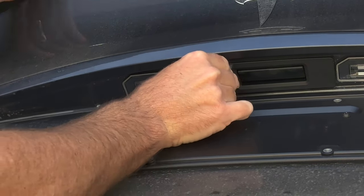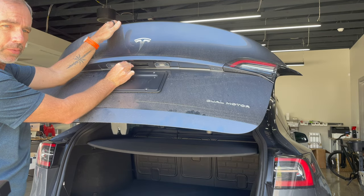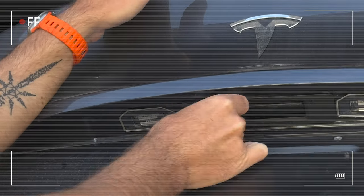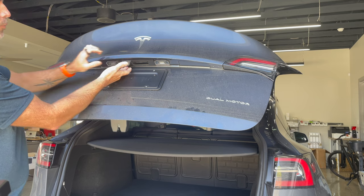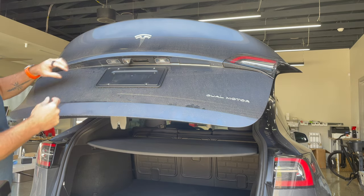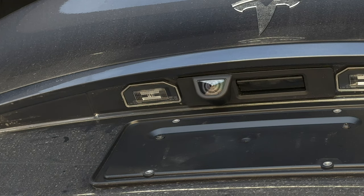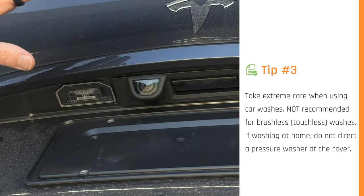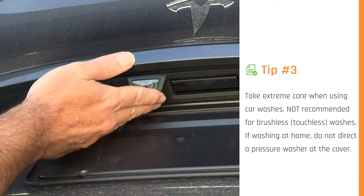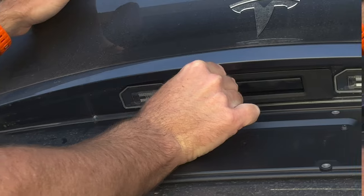Once you're happy with it, go ahead and apply some pressure for 30 seconds. When applying pressure, do it on the front edge but make sure to get the back as well - that'll make sure it's nice and watertight. Ideally don't drive your car for 24 hours, and especially don't drive if you're going out in biblical weather - rain, snow, sleet. Before you do drive next, just check that it's still adhered properly.